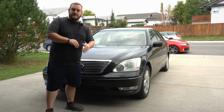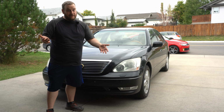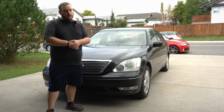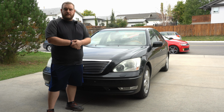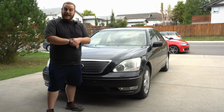We're gonna clean up these headlights as well, see if we can get those back to looking fresh and be safe too. You know, headlight restoration, big thing is safety. You wanna be able to see when you're driving on the road. And later here in the year, the sun's going down earlier and earlier, so we have less and less daylight. So super important to have. So again, do a quick decon wash here, do a clay treatment, and then bring it into the garage and start to polish. So stay tuned and enjoy.